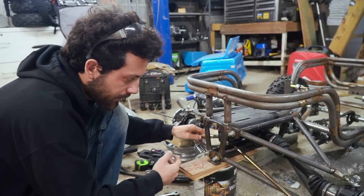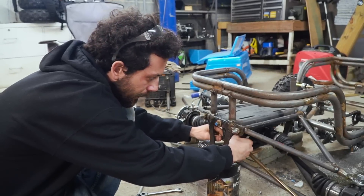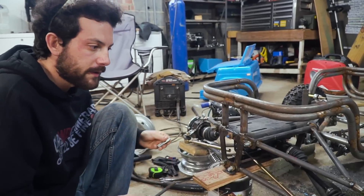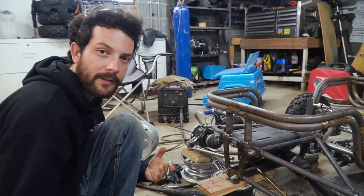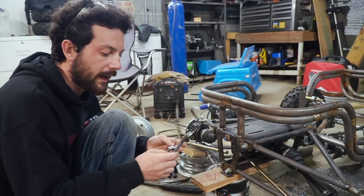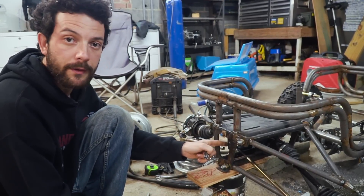I just need to take these makeshift bolts out, cut them, and weld our steering eyelets to them. Gopowersports sells all kinds of steering parts, but we used part of a kit a while ago so now we're coming up with our own solution on this end. When you buy your own steering kit from them it will be all-encompassing and you won't have to do what we're doing. I need to cut it, thread it back in, weld this on the other side, then we should be able to bolt it right here.